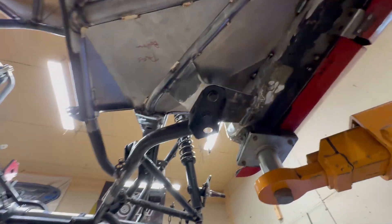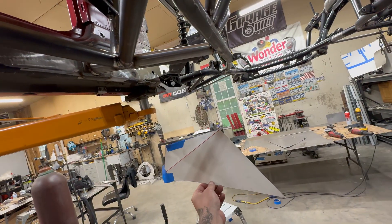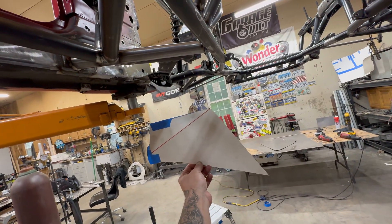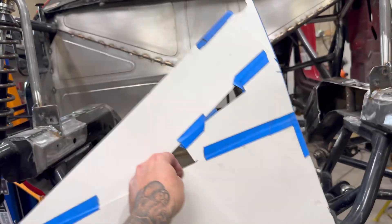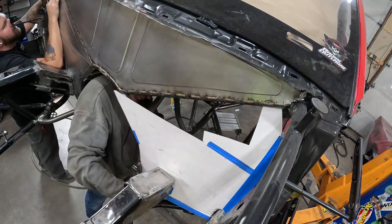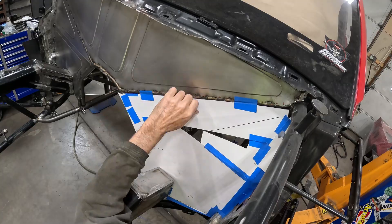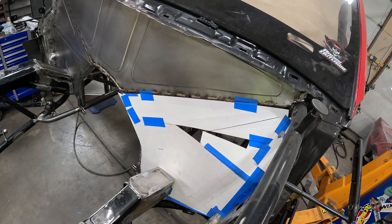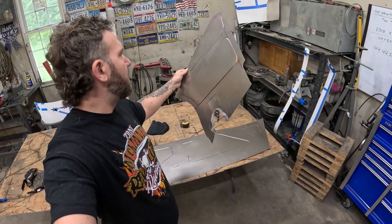I didn't show you guys this part where I made these two pieces for the start of the floor where it meets the firewall. I need to do it on this side and I have the template from the other side, so we'll put it up in there, hopefully it fits, and cut it out. We've got both pieces in. Now we're going to try for the last piece of the firewall — we have the old template. My dad made the template for the driver's side — he used the old template just flipped over. It should be the same, close enough. There we go — the last piece of the firewall. Let's get it cleaned up and tacked in.